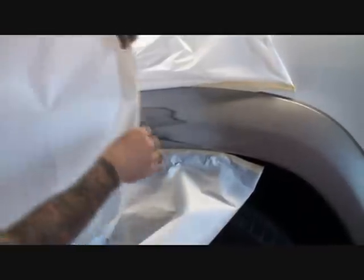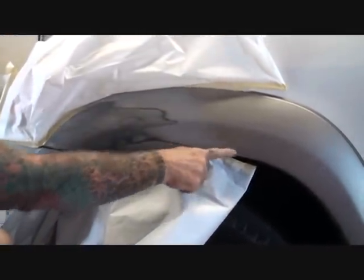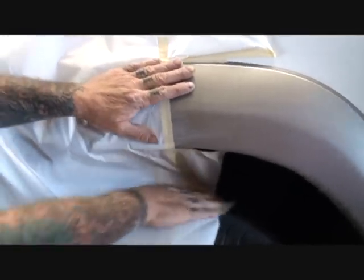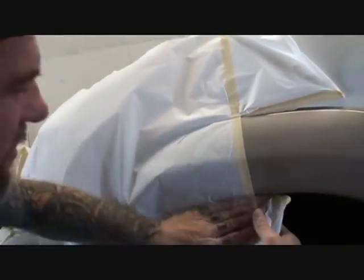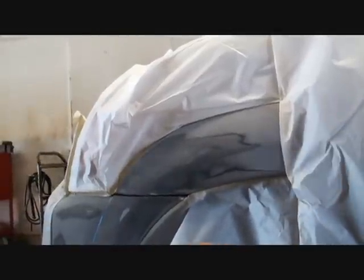Here's a good example. I'm going to put my paper where it's actually covering the area I'm going to prime, and if you look right in this area, you'll see where I stopped sanding. So I'm going to come back to where I stopped sanding, and then I'm going to fold it back. If you see right there, now it's got a soft edge instead of a hard edge. So when I sand that, it'll be a lot faster, easier, and quicker to do.